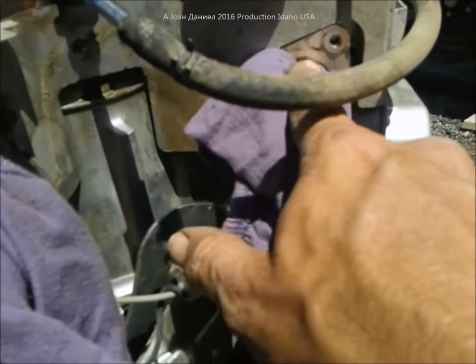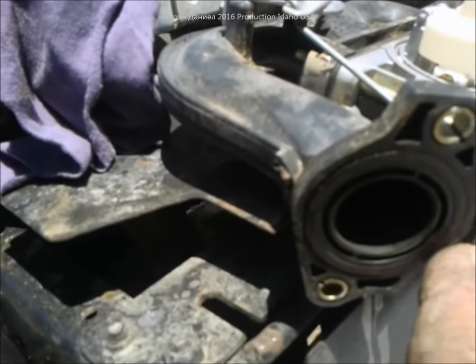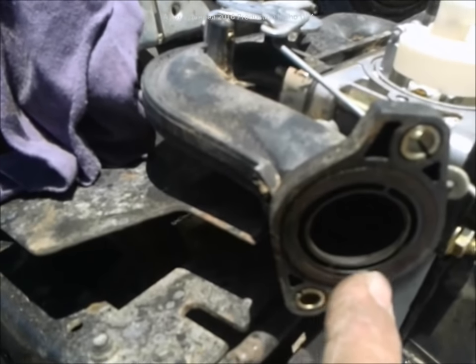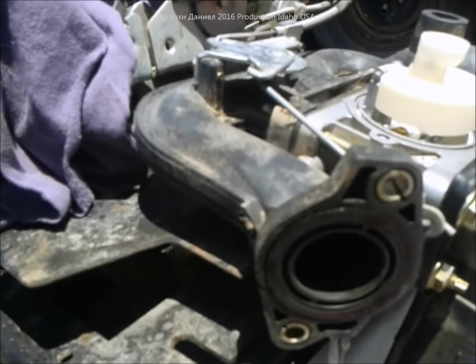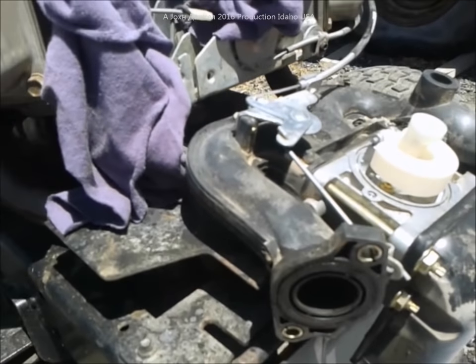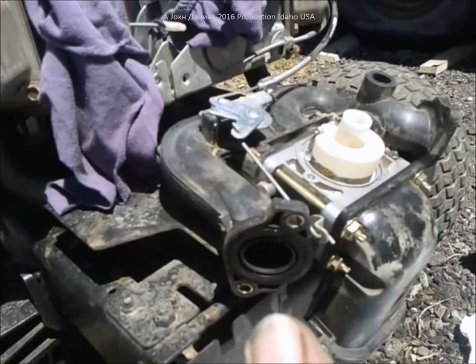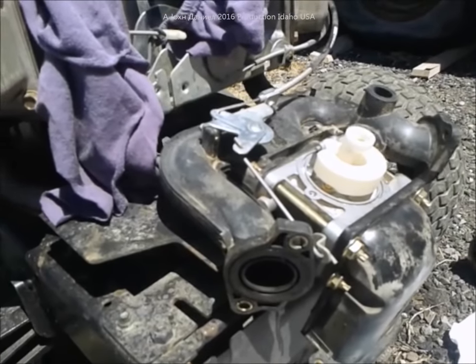When you pull this loose, you want to seal that up. These come with a reusable seal on them. I suggest cleaning them very well and putting them back on and torquing them down to about 20-30 inch pounds — somewhere in that neighborhood. Check your manuals on it. Me, I just torque it down enough to where I feel like I'm going to break it, and I stop.